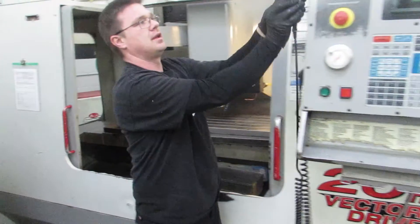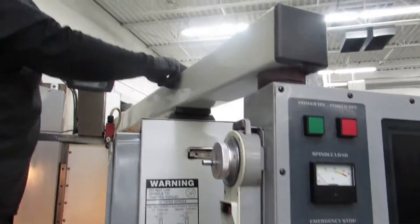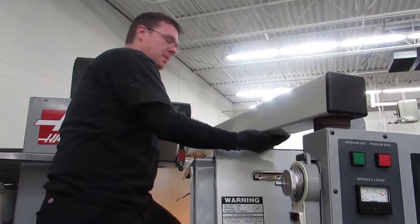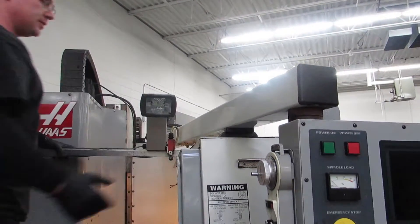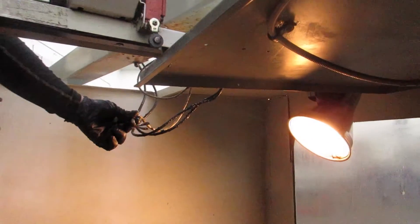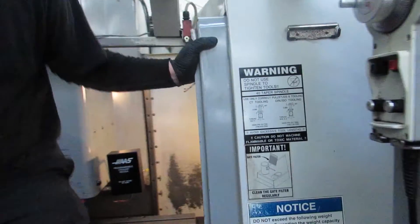The other special thing for the VF3: you'll have to climb up. There'll be one bolt here — remove it, a three-quarter inch bolt, using a Crescent wrench or wrench, whatever you choose. Also loosen an Allen head bolt back at the knuckle where the arm separates. And don't forget to remove the power source for your interior lights — otherwise, when you move the control arm back, you will rip them off.